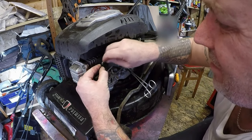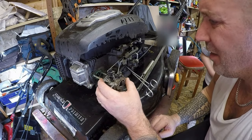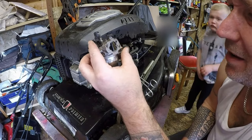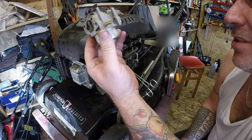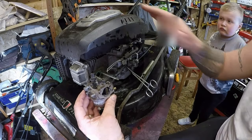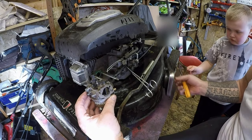We've got a gasket to come off. Now we want to take the throttle linkage off — this has got some gaskets on here that perhaps it shouldn't have. I think someone's had a little go on this one — could have been Jeb. The throttle cable comes off and we've got a gasket behind here. That all looks pretty good, and it says 'Champion' on here — it is actually the right carburetor for it, GGP, etc. So we'll get this carburetor onto the bench, dissect it, and see what we can find.